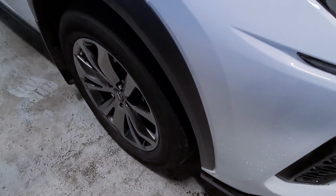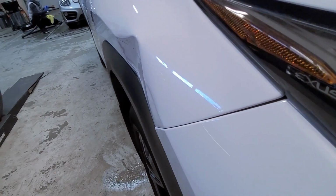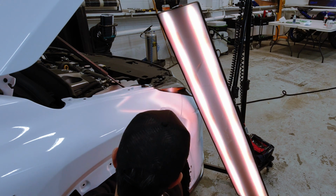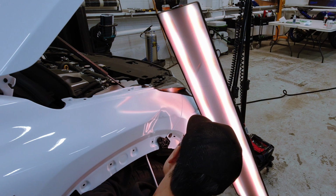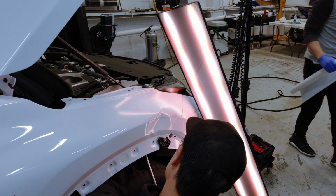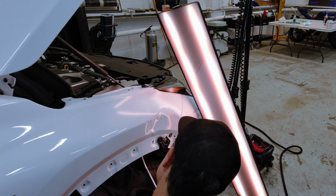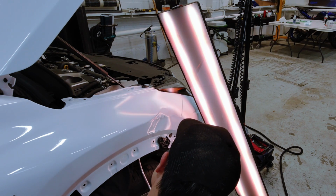And guys, sometimes you really just have to heave on a dent. It's a sacrifice move, but sometimes we just gotta get that general structure back out first before we start doing our refinement, or else we don't get that shape at the end, and you have to do it later anyways. So what I'm recommending here is using some hot glue on the face of this dolly head. This is going to give you a really strong, flat surface to push off of to get that shape back.